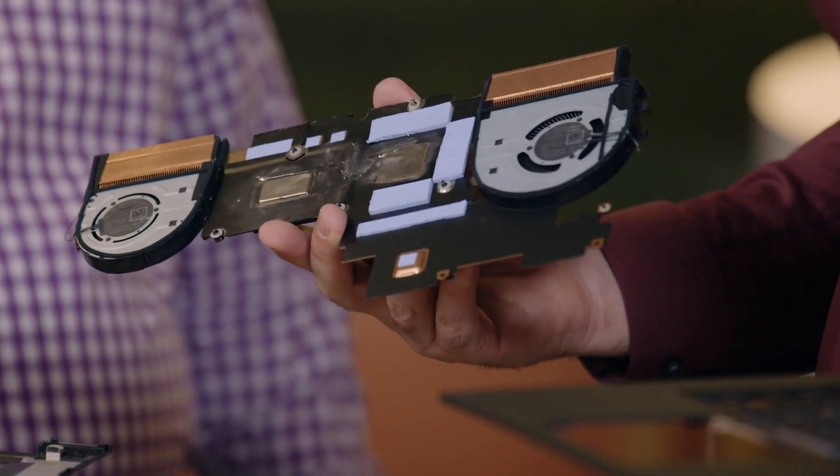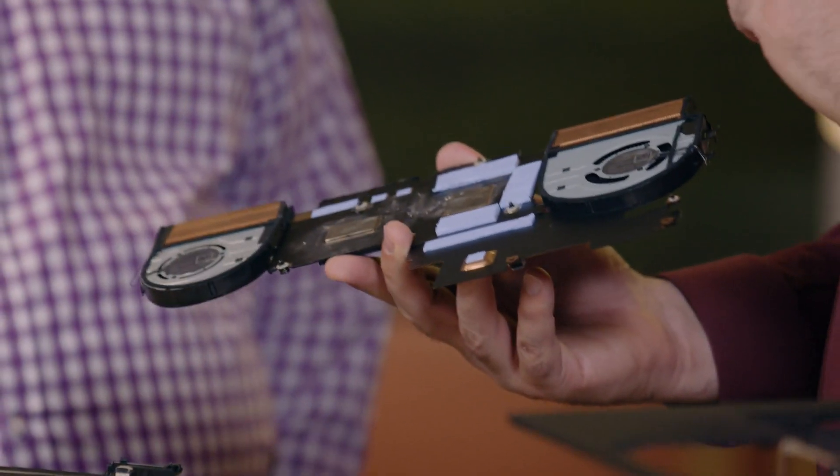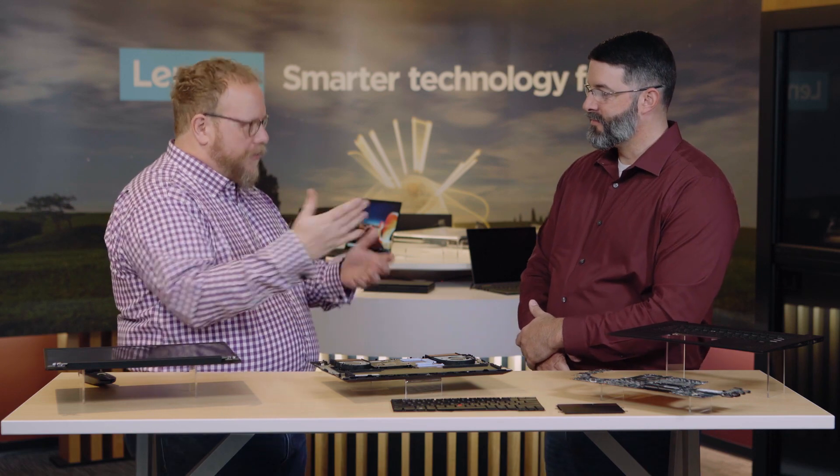One thing that historically has troubled laptops — not just ours but really any laptop — is cooling fin clogging. Our team did fabulous work years ago where they took fans from many different environments, sent the material found in the fans to a medical testing laboratory, and figured out that if we built fans so that static electricity buildup was constantly grounded off through the system's ground, we could practically eliminate almost all dust buildup. All of the things we've done inside this machine — we really have to thank our partners at Intel and NVIDIA for their close collaboration and tens of thousands of engineering hours. They really helped make a chassis like this possible. This has been fabulous — thank you all very much.